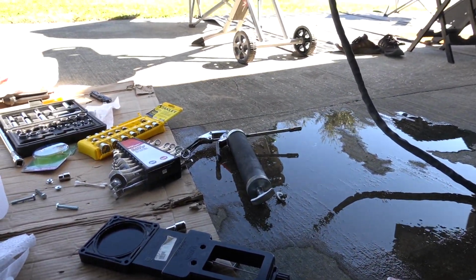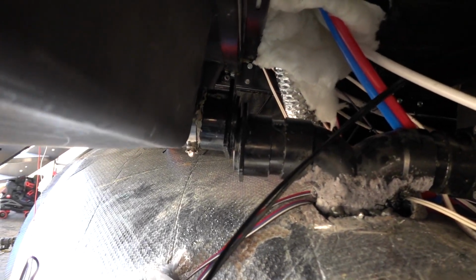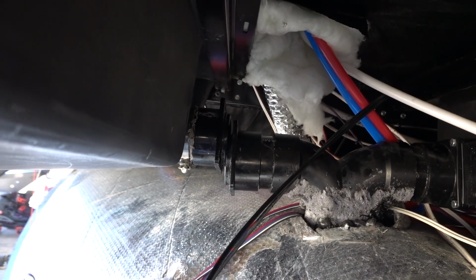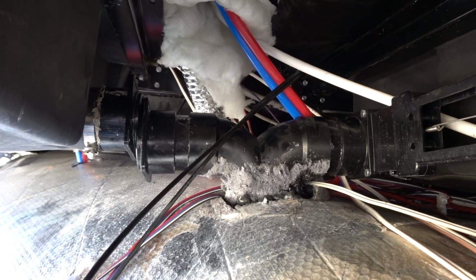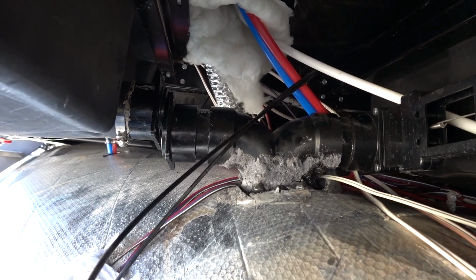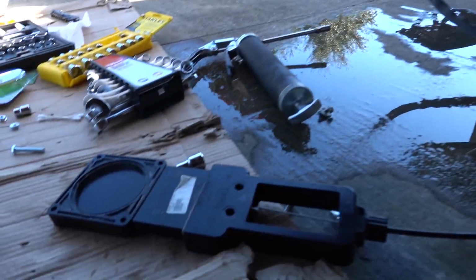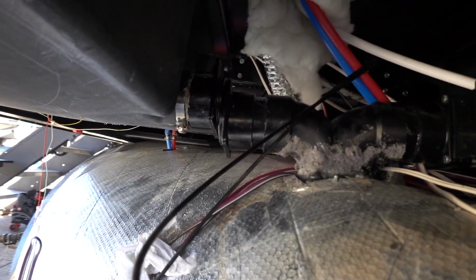So I have a bar, right, where's that? I lost it. But I have a big crowbar. I can probably bend it just enough to keep the pipes from, you know, of course, warping, and then I should be able to squeeze the valve in between these two seals without them coming off. So that's why you're going to need a little bit of silicone grease. I'm going to add a little bit of silicone grease to the valve now. That way it kind of slides in between these two pipes.